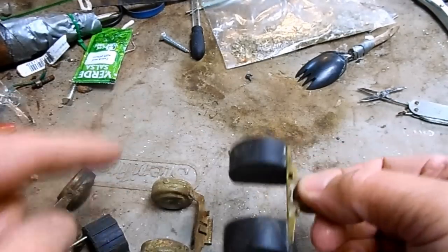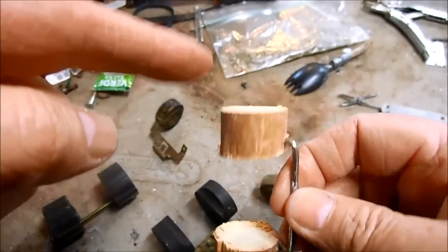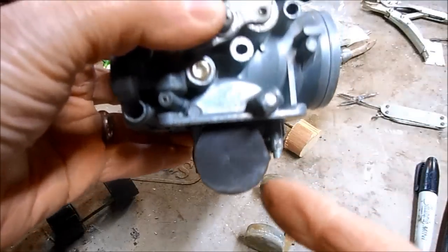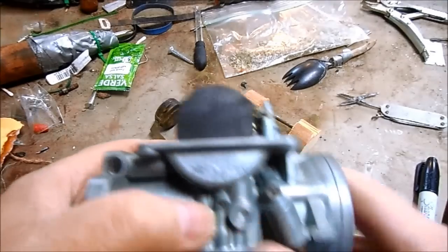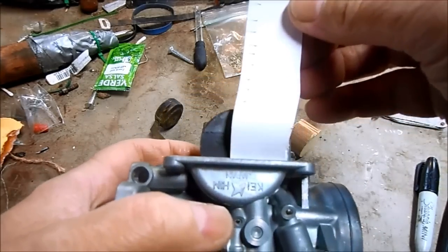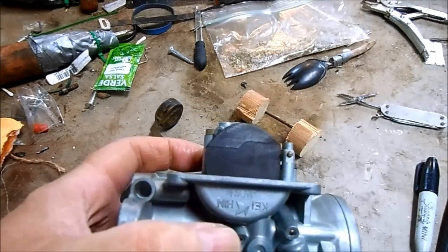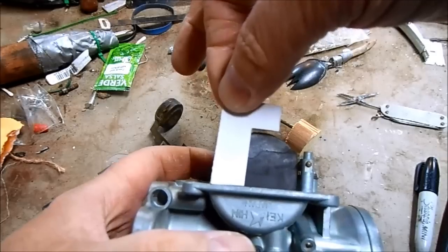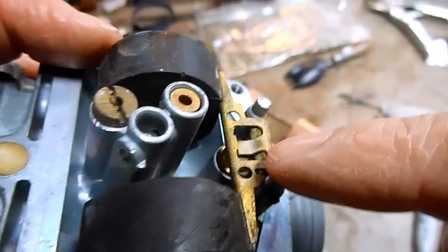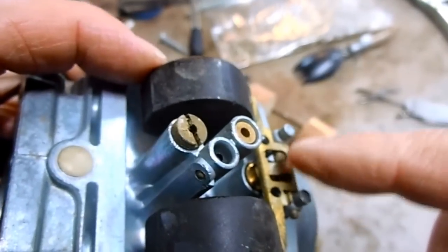It's important to check and make sure there's no air bubbles. Harley-Davidson floats get saturated fairly easily and don't last a long time. Once you have a good float, you need to set the level correctly — turn it upside down and measure the number of millimeters, making sure that matches what's in the book. Usually it's measured between the gasket surface and the top of the float. Some companies also have gauges; you just put that on your carb and make sure it lines up with the top of the float. If the float is too high or too low, you just bend the tab to adjust it up and down, because the tab actually rests on the needle valve.